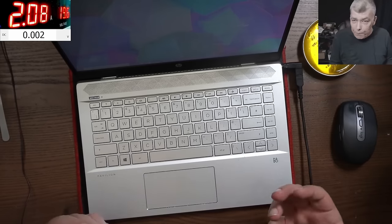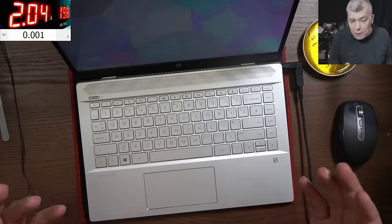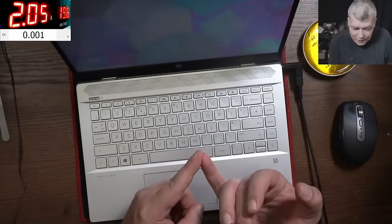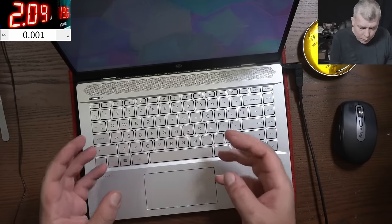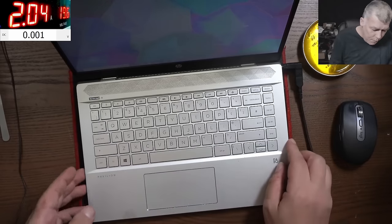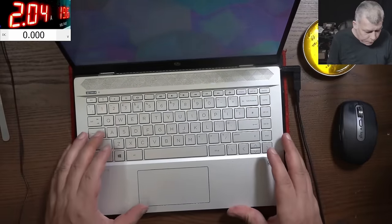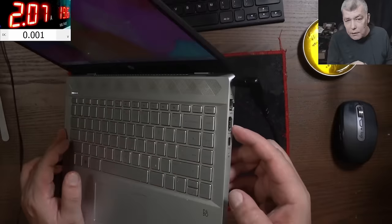Now, if the caps lock is working, then you are dealing with a different kind of matter. That means your laptop is processing, so the brain is processing the data, but it's not displaying. In order for the screen to display a picture, you need what? You need backlight, yeah? And for the picture, you have a multiplexer, a chip which is switching the video between the HDMI port and the screen. Yes, it has an HDMI port. So probably the next step, after you see the caps lock is working, is to try with an external HDMI monitor.